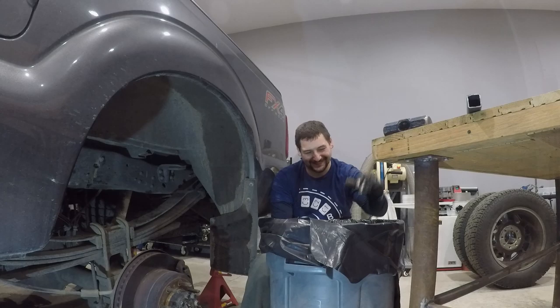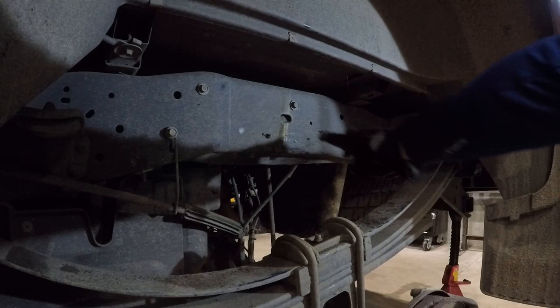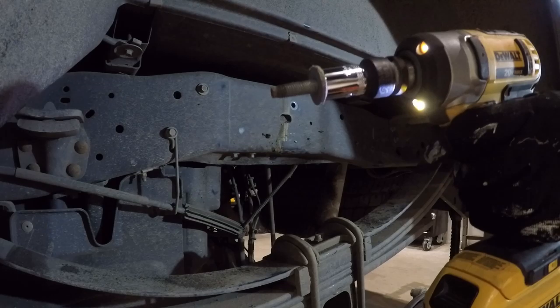So on the left side of the truck, there is a bolt that retains the bracket on the aft end, or the back end, of the urea tank. And that bolt is right here. So we need to undo that bolt and then pull the nut cert from the inside. That bolt will get thrown away. It does not get reused.